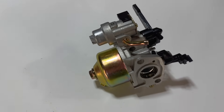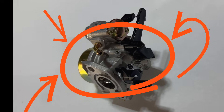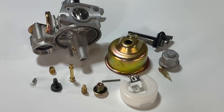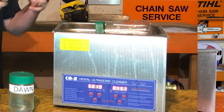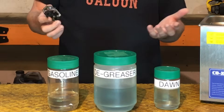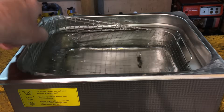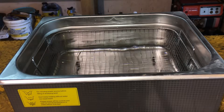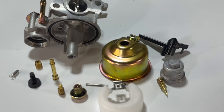And here's mistake number four — the one that makes all the other steps pointless if you get it wrong: not disassembling your carburetor enough before cleaning it. I see this all the time. People think the ultrasonic cleaner is going to get into all those little passageways, so they don't take it apart. Wrong! If you don't disassemble it properly, you can have passageways that stay blocked and the carburetor's not going to run right. Completely take your carburetor apart — if it can come apart, take it apart or those passageways aren't going to get clean.